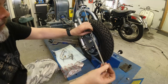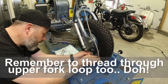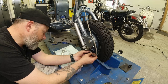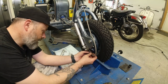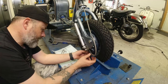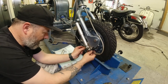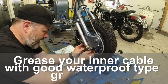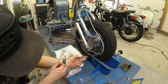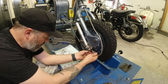Then take your screwy bit, put it up to the olive — I should have probably threaded it through there first, but it fits. Take it round to the speedo drive and get the olive to sit there. I'll sort that out with a pair of pliers just to take the rest of the threads up, and then fit your rubber boot — job done.